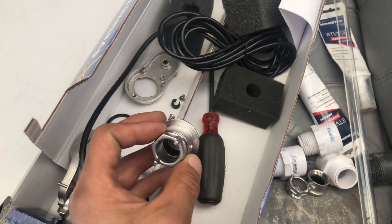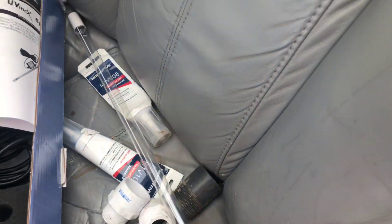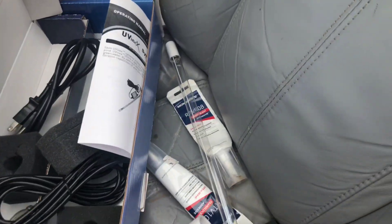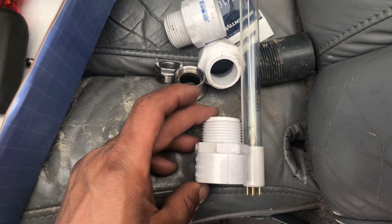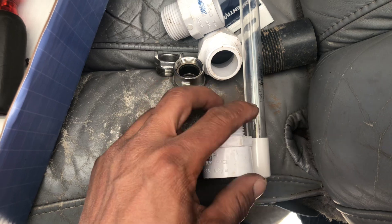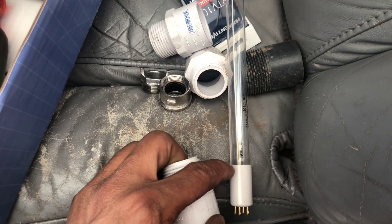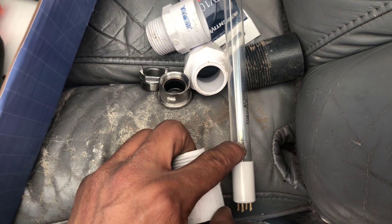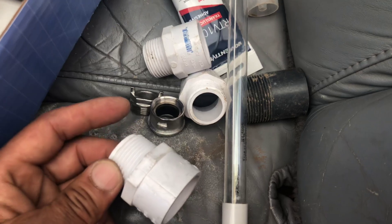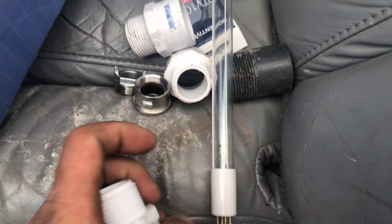Welcome back. This little piece I found holds everything watertight — it gets fitted onto the collar of the bulb where it doesn't get hot. What happened last time was I fitted it with silicone all the way inside, but there was a void I missed right next to the bulb area. I discovered a small hole and a big crack inside the sleeve, which I think was caused by heat building up inside that little bubble of air surrounded by silicone.